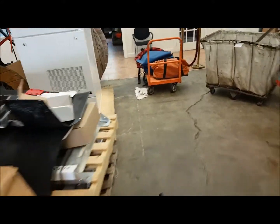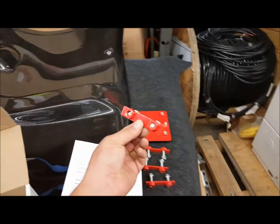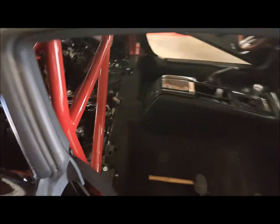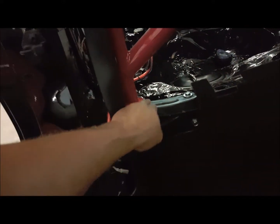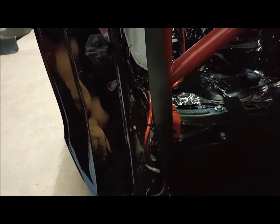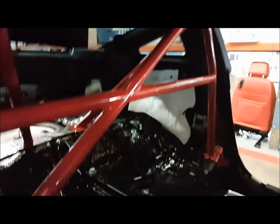Once the holes are pre-drilled, we can install the backer brackets to the gussets with rivets. The one side of the seat bracket, which is the passenger side, has to have a 7/8 hole drilled so that the gusset will sleeve over the cross member framing once it's back in place, because these brackets make it a little snug, so you got to make room for it.